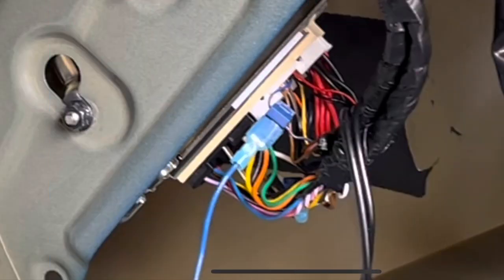The only wire you will need in the other amp harness is the remote turn-on or accessory-on wire. This wire will not need to be cut. You simply tap into the wire. It's located in the white, or in some cars yellow, wiring harness and is blue with a pink stripe or solid blue. I ran this wire to the subwoofer and amplifier.